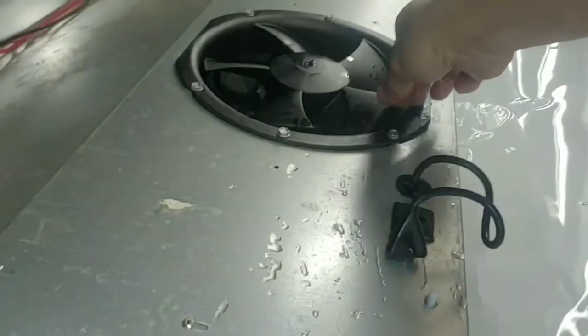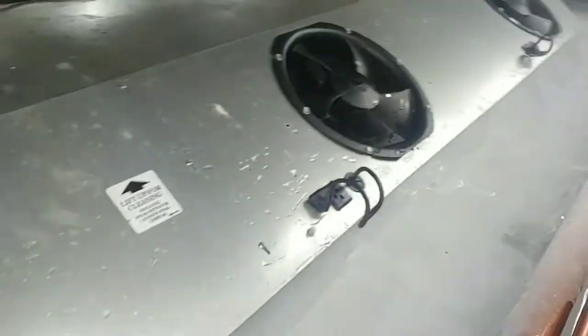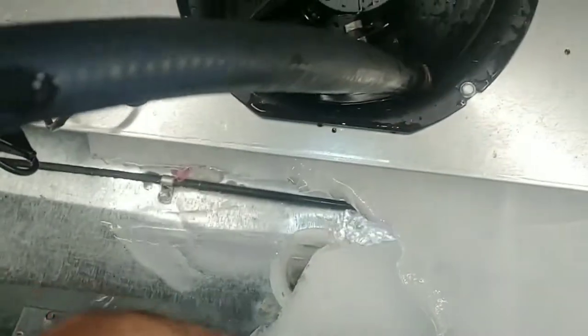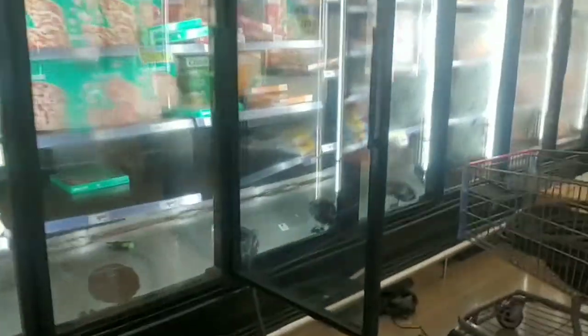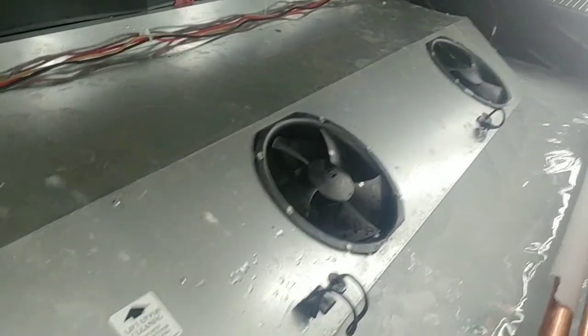Half the case is looking good, making good progress. Hopefully y'all are getting something good out of this. It's really simple — start by finding the drain. In this case, all five doors were covered in ice, so I went to the adjacent one, checked the model number — it's the same — and found the drain there, because there's no ice on that one. The drain is in the very center, so that's how I knew where it was. Get the drain clear, melt all the ice, get all the ice from behind the evaporator cover — that's what you gotta do first.